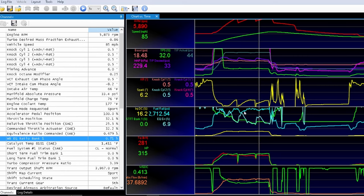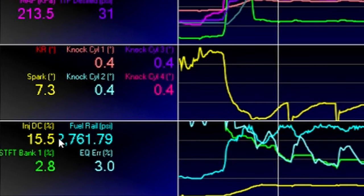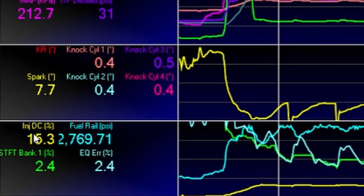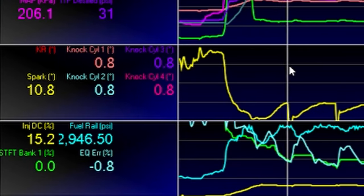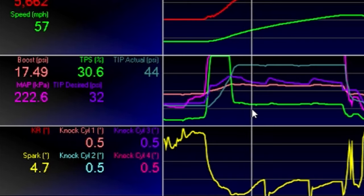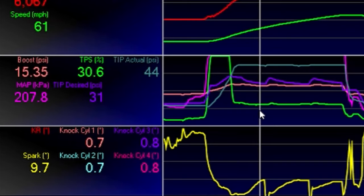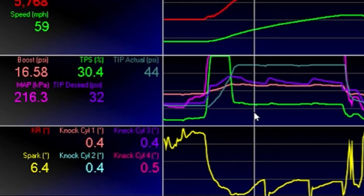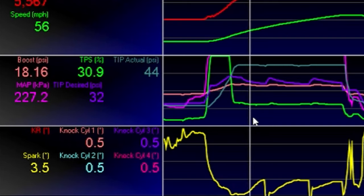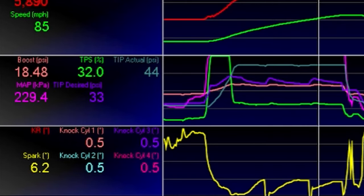I got the injector duty cycle number working — I don't know if 15% is the right reading, I still need to figure that out. Otherwise things look pretty good. On tip-in the throttle plate closes to about 33% and stays there. There's probably a way to adjust that, but since I've got the overboost fault figured out, I want to leave the throttle closing as-is. The throttle plate can react a hell of a lot quicker than the wastegate, so for safety I'll leave that alone.